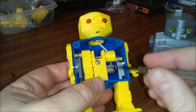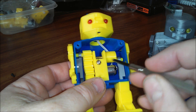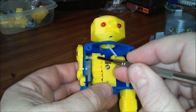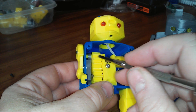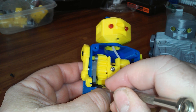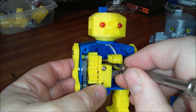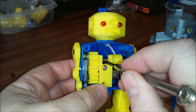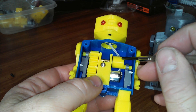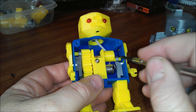This is what's inside the toy. This is the N20 gear motor — it drives this 10-tooth gear. This is also a 10-tooth gear that makes up the crank for this pin. This is the pin that is referred to in the term 'pin walker.' It's also connected through either an 1/8-inch or 3-millimeter shaft to this crank over here. You'll notice that these posts are 180 degrees apart.